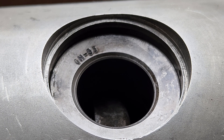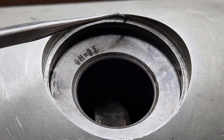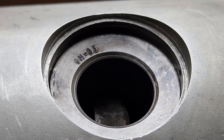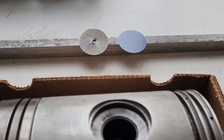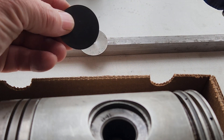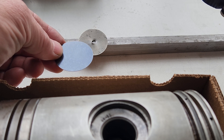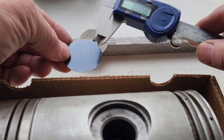The actual machined edge runs the same diameter on the outer portion of the cut, but as it goes deeper you can still see the ledge. I think a lot of people think you have to crease these retainers, but I believe it's all spring steel and side pressure is what holds them in. If you crease it, you're not going to have side pressure. We're going to try to install these with an arbor press.